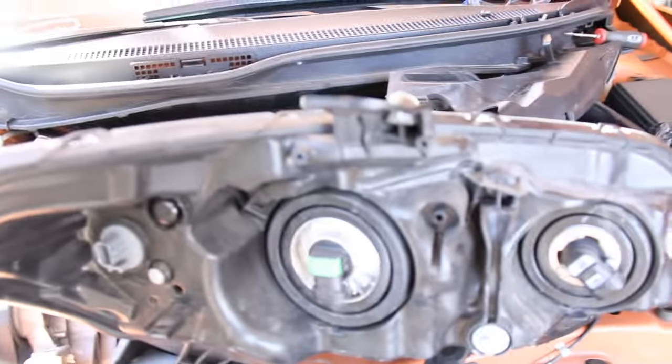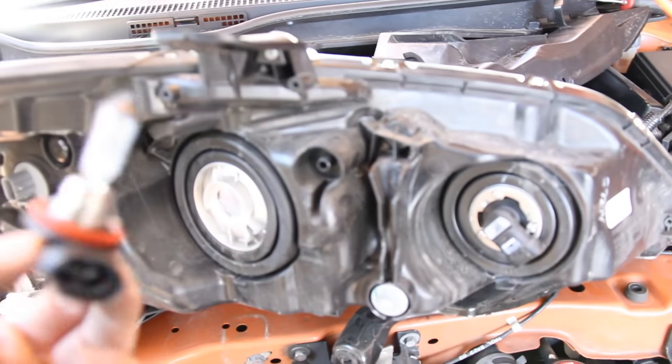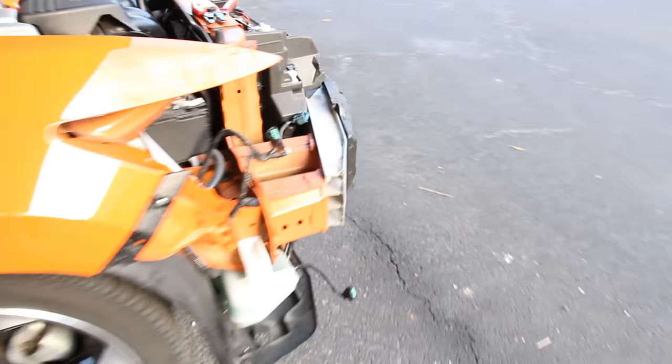Now that we've got the headlight up here ready to work on, everything else is pretty much simple — it's a twist to take it out. This is the main headlight we're going to be changing today. Do not touch this bulb because the oils in your hand can make them wear out faster. Just twist and pull it right out. A couple of days later — on accident, Jeff sent me the wrong size for the car. So I already went through the process of taking apart the front end again. It's three bolts one more time.